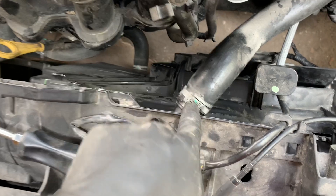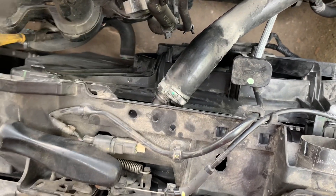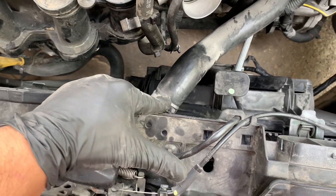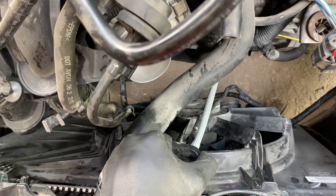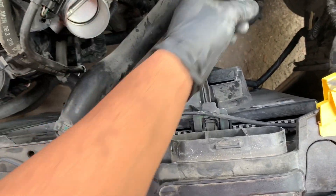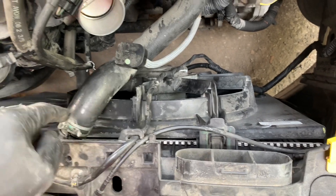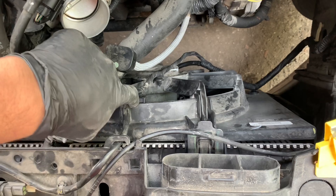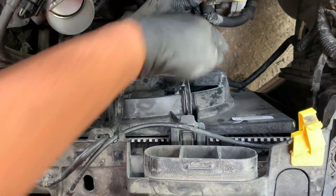I'm going to start with the bottom hose to drain it. It's just like this top one here — just push these two tabs on the hose clamp together, pull it back, and pull the hose off. So I'm going to do the bottom one to drain the coolant first, then come up top and do the same. Once I do that, I can start working around everything to get the fan out. This here you can just kind of pull out — it's just connected to a clip, just put it to the side. You can also start pulling the tabs off the fan now or after you remove the hose. So I'm going to remove the coolant, get these hoses out of the way, and start removing these wires off the fan.